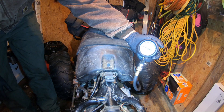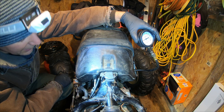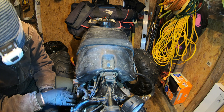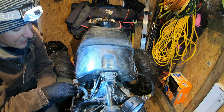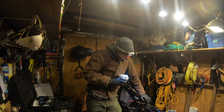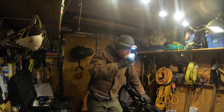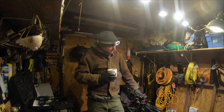We're at 54 — only 4 to 6 psi up. One thing I didn't do is inspect the valves, and ultimately I think that's going to have to be done. There's a new top end, new rings, new cylinder, new gaskets, tightened down nicely — still very low compression. I'm going to take the head back off, and before I keep going and making assumptions, I think it's time to do a proper leak-down test. I should have done that early on, but I was fairly confident the cylinder and piston were the issue — and they were, but it doesn't seem to be my only issue.